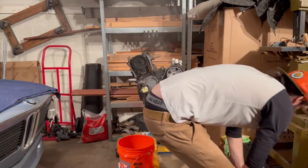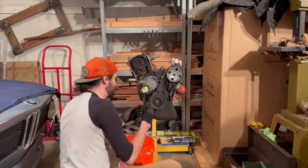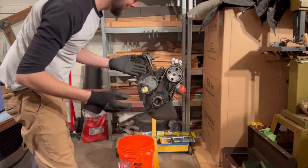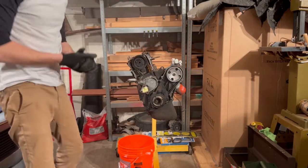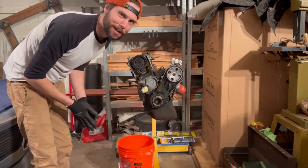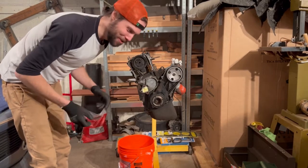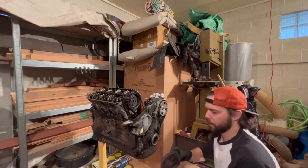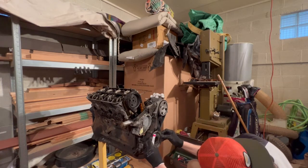It's already hot enough. Great success! That was really spicy — burned some grooves into my work gloves. But talk about a victory. If you remember from the last video, I struggled with that for like 45 minutes trying to get that pulley off, and this tool does it immediately with no tappy tap, no prying, no nothing. I don't want to make an ad for a tool I'm not sponsored by, but I'll be damned if that doesn't work like it's supposed to. Now, one thing I want to keep track of is timing marks, and this pulley looks like it could be installed 180 degrees out because those holes are not offset.